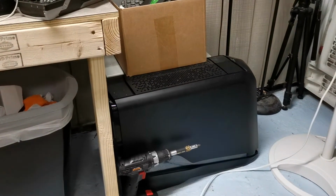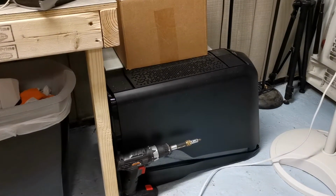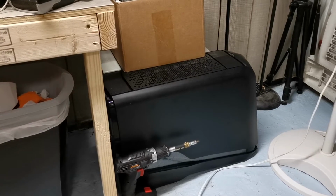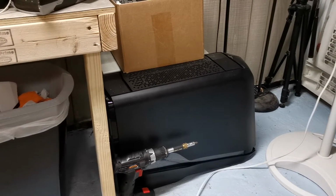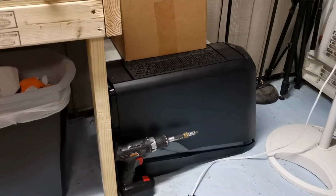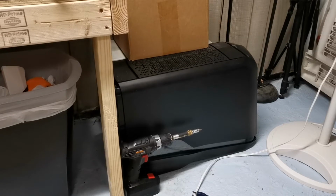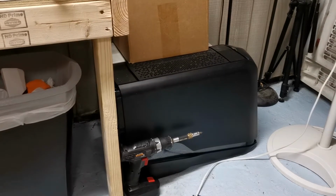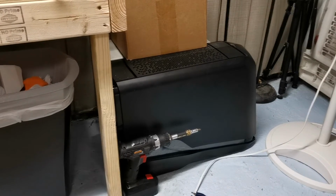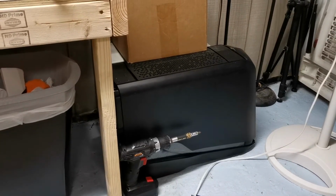The next day he calls me, says it won't turn on. So I went over there, reseated the RAM, tried to see if maybe that was an issue, because that is a common problem. Nope, that didn't solve it. Took it home, did probably 4.5 hours of troubleshooting on it before I decided I'm just going to take the motherboard out. Took a look at the motherboard, and the back of it, it was very strange.